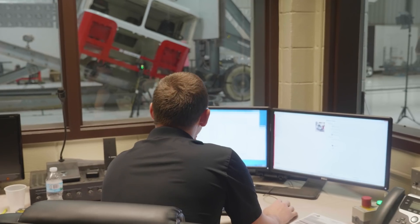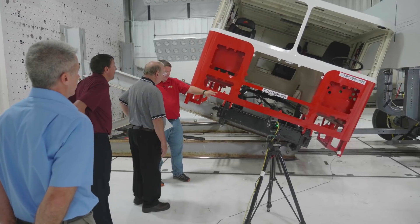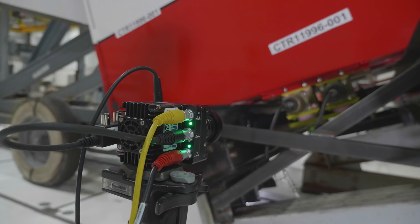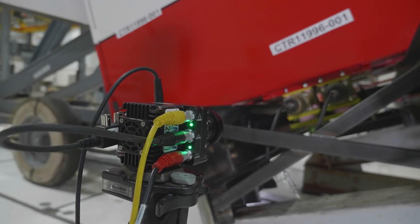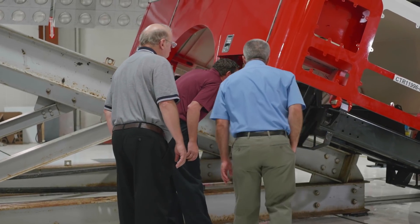Our Full Tilt Cab underwent three types of validation testing. The tests we were here to perform was NFPA-defined cab integrity testing. We're primarily looking at the body attachment points, so your two cab mounts up front. We have another high-speed camera that's on the rear. Basically, it's testing the unit structure between the cab and the chassis and occupant space and retention.